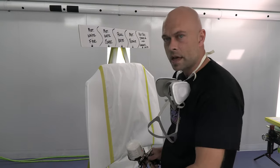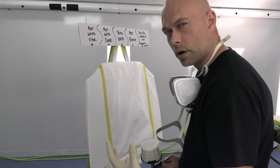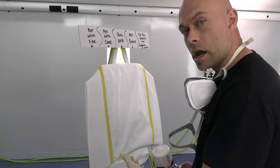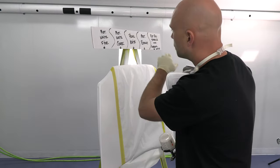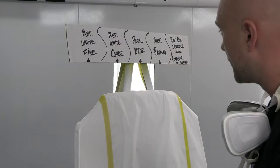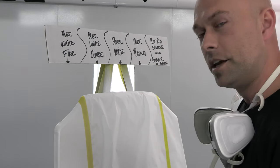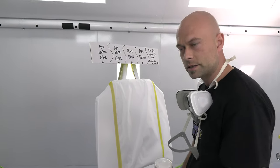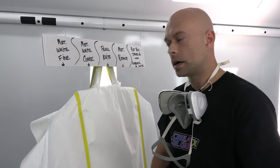You can see I'm not overly wetting that — that's a medium wet coat. With that ground coat of sealer it just makes everything that much easier. I'm going to tape out the next section and do the coarse, the pearl, and the platinum the same way. When I get to the hot rod sparkle white, we'll stop and show you how we recommend putting that on — you can see the difference is really just a technique in terms of spraying it.